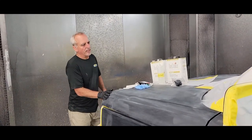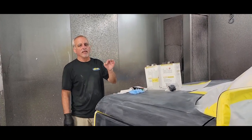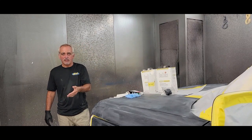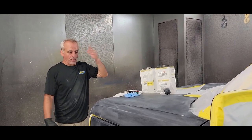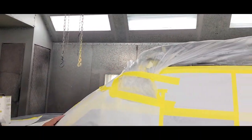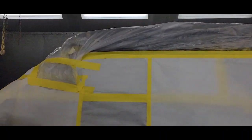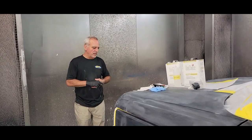There's no way I could get the dirt out of the molding, so what I did in that case is I sprayed the base coat. Before I clear coated, I tacked it off. On my first coat of clear — I usually don't do this — I just sprayed a real light tack coat, hoping the overspray went inside the molding and would hold that dirt down. It did for the most part, but I still got some chunks out. On the previous video, I had this all masked off with plastic and I sprayed just the roof and the front bumper. Since the post pillars weren't painted, I folded the plastic up into a nice neat square up there and it covered the roof. So today all I have is the bottom of the vehicle, no front bumper to deal with, so it makes the job a lot easier. If it's hot anywhere, that's a good idea — do the roof first.